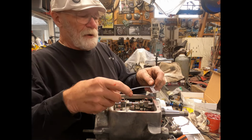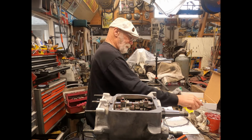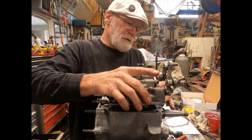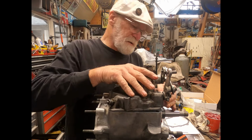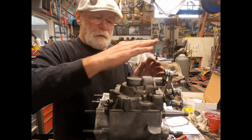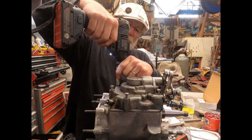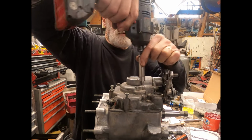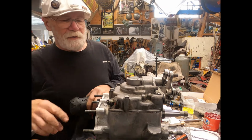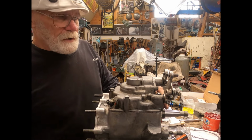That's good. All right, so we're going to put this gasket on. The pin lines up. And then I'm going to smear on this rotary cap, put a little bit of grease on it. This on there. Line up my pins. There we go. Okay, we're going to put these in. These are set about 7 to 9 foot pounds right there. Tighten that down. So this is all together now.